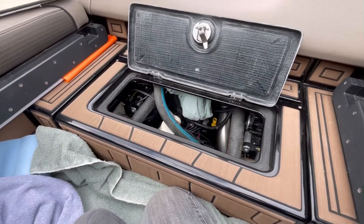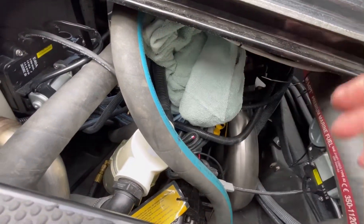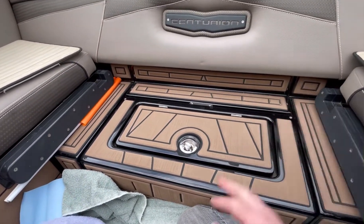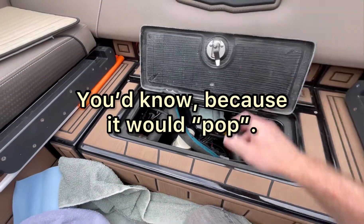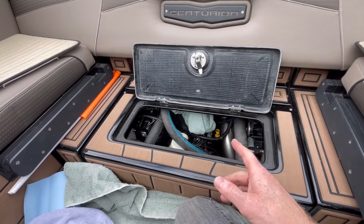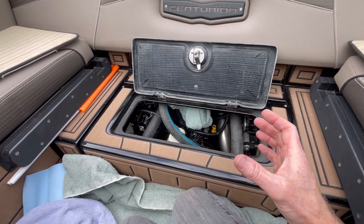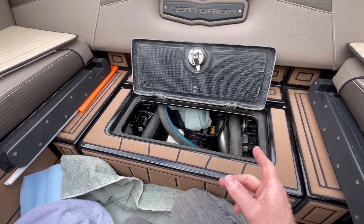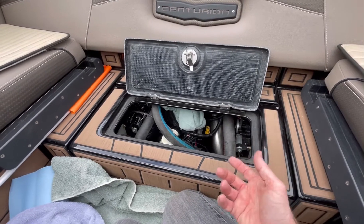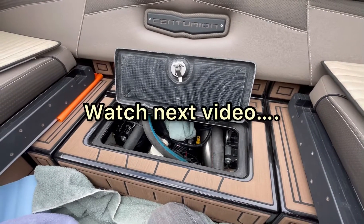I just wanted to add this at the end of the video on the oil change. I went ahead and wrapped a towel around the oil filter and had the door closed so that oil wouldn't come out if the thing blew — and so far we're good. Like I said, in my entire life this has only happened once, and it wasn't due to a double gasket or any kind of flaw I could see. The only thing I can figure out is that because I pre-filled the filter maybe there was too much pressure initially, or perhaps it was over-tightened and it deformed the gasket. But right now we're good — thanks again for watching, please subscribe.